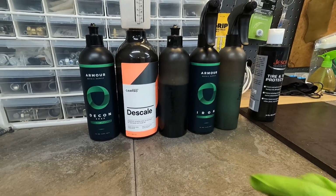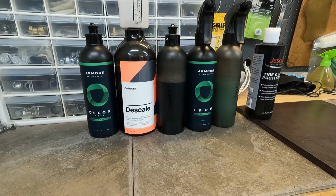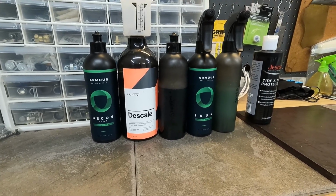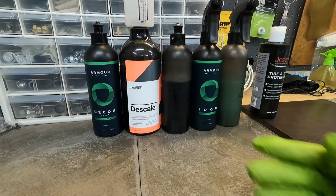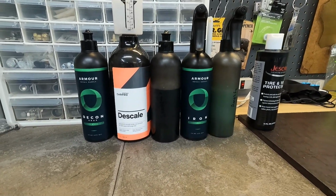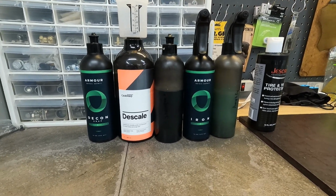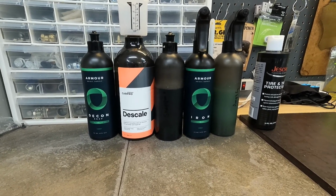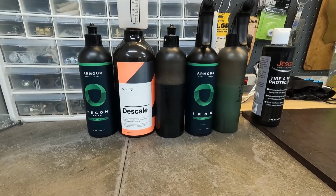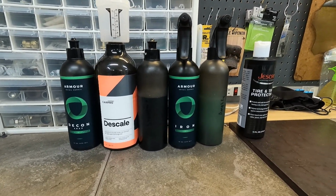Rinse everything off, and that really cleanses the coating and unclogs the coating. If you do have some sort of mineral deposit, you may have to use mineral deposit remover in this part. And then of course you come back with your iron remover to remove any industrial fallout, because this car does sit outside 24/7, so I'd expect there to be some sort of fallout onto the coated surface. So just spray that, rinse everything off, dry the paint off,